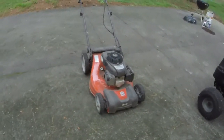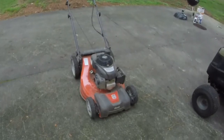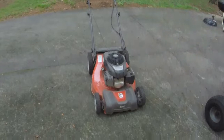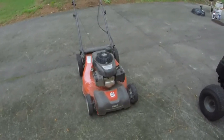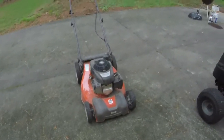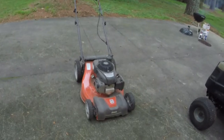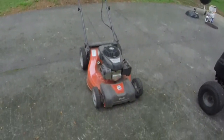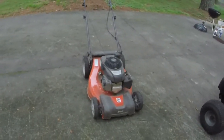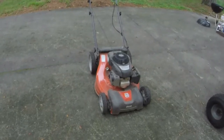That's good. We still obviously need to put it back together. All that grass caked up caused the belt to slip off. If you've watched Mick's Mowers, he had a very similar one a while back where a push mower self-propelled stopped working — the grass got so clogged because it was missing a piece and ended up throwing the belt. The exact same thing happened here. Let me pull up the manual and parts diagram to see if it's actually physically missing a piece or just a poor design by Husqvarna. I think it's the former, because I don't think Husqvarna would be that dumb.